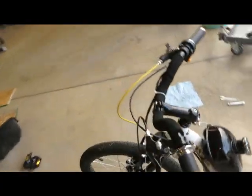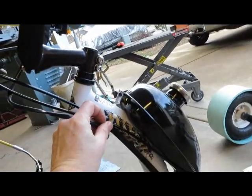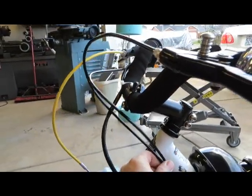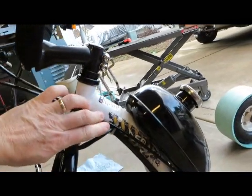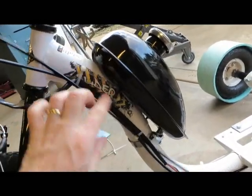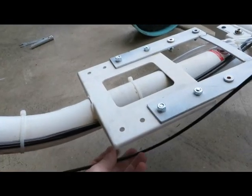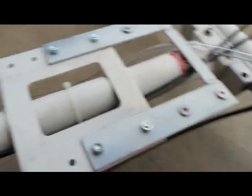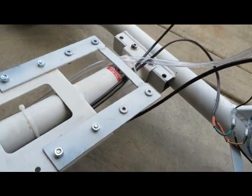Now we just need to route the clutch cable. Leave about a little loop like that for the clutch cable up here, so that way when you turn the steering wheel it still has some room to move. Then everywhere there's already a cable tie, add another cable tie to hold the clutch cable in place and route it on top of these cables that are already here. Cable tie there, cable tie down here, then hold it up under here — put the cable tie right there. One more cable tie right here. Don't put one back here because it won't reach — it goes right up into the engine. And that will mount the clutch cable.